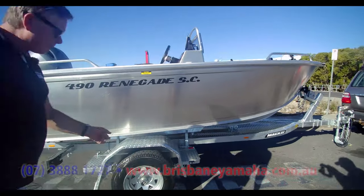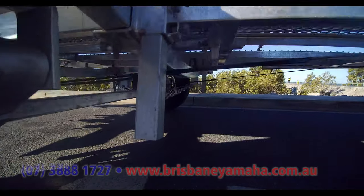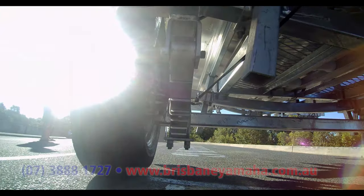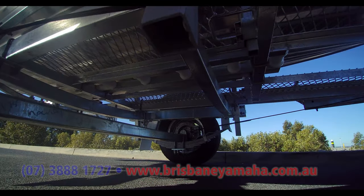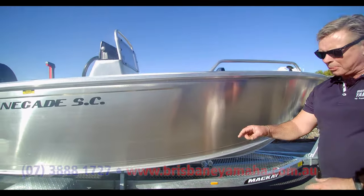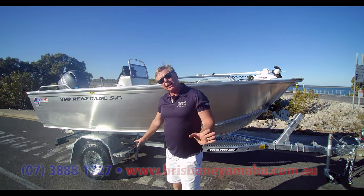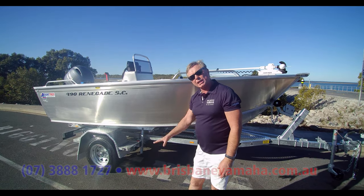Big bearings there. Come back and have a look at that suspension. When you get into the rough stuff, if you've got a normal trailer you've just got the slippers — the spring just goes into a little loop. And you go over some big bumps and those springs just fall apart. Well, this is loop to loop so it can't. This could go over anything and the shocks will just stay in place.